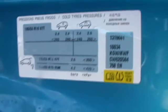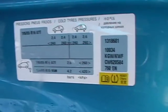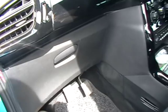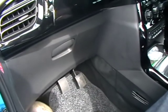Tell me where you would find the information for the tyre pressures for the car and how the tyre pressures should be checked. You can find the information on a sticker located on the inside of the passenger door, or inside the glove box in the manufacturer's handbook. Tyre pressures should be checked at a garage using a reliable pressure gauge, and should be checked in the morning when the tyres are cold or before starting a long journey.